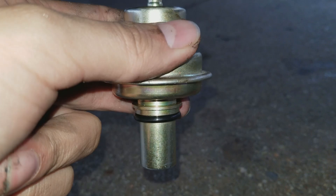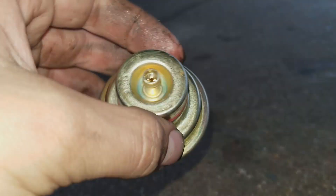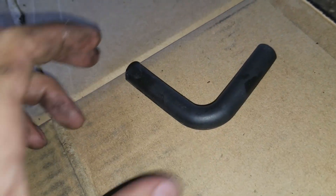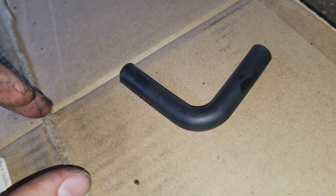There is a small set screw in there. Use a tiny flathead screwdriver and you can twist it in or out, which can change your shift points. Just put a little bit of ATF on the outside of the ring. They give you a right-angle piece — just cut off a small section. You don't need the right-angle piece; in my vehicle, all you need is a straight section.